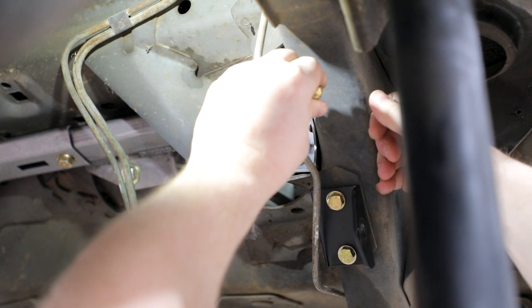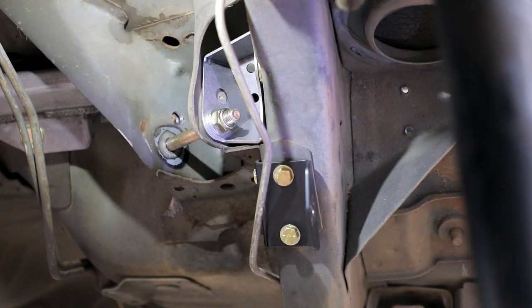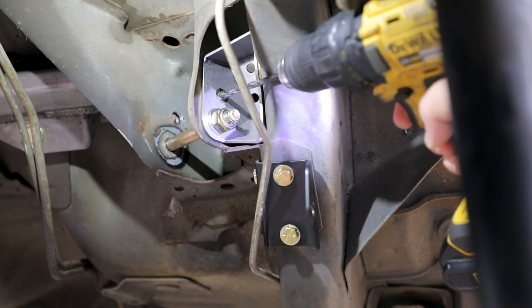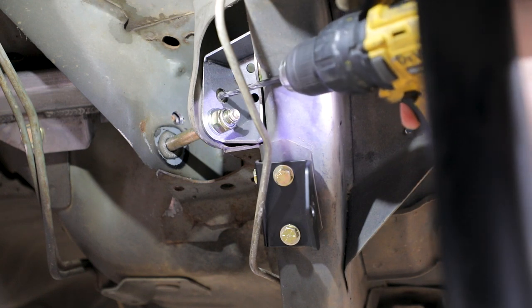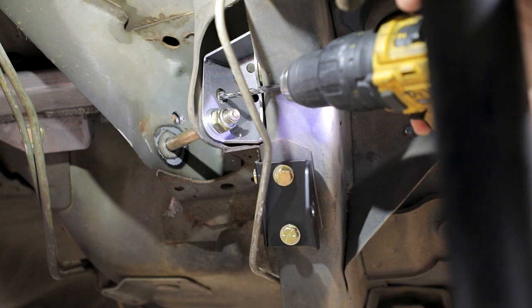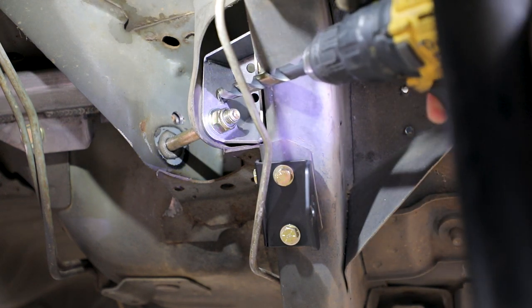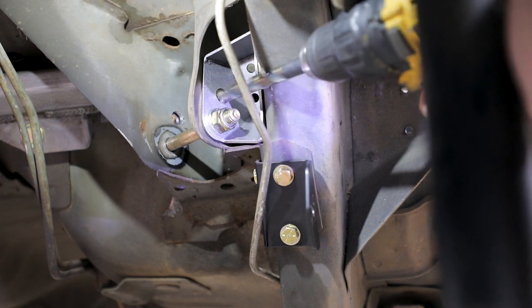Use a snap punch to locate the center of the upper hole in the swivel link brace weld assemblies. Drill a pilot hole through the two marked locations. It is recommended that you gradually step up in drill size before drilling the half-inch hole. Drill to a final hole size using a half-inch drill bit.